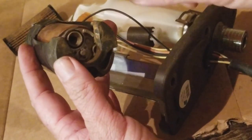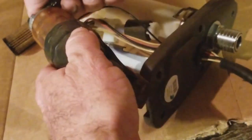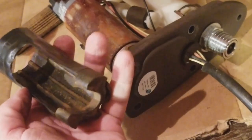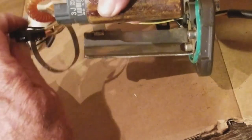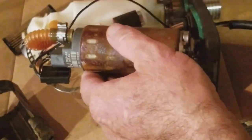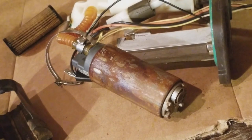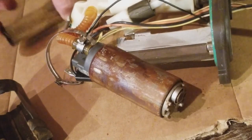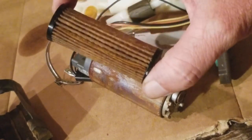You'll see when I go to plug in the new screen for the new pump. All right, so I'm going to recycle this. And then here's my old pump. Unplug here. That comes out. Make sure that's plugged in really good when you go to replace it. And then basically, I'm going to go ahead and undo this hose. I may cut it with a razor blade because I have a new hose to go with it. So let me get this taken care of. And there's our old fuel filter right here. Said and done. So the bike should be running better just with that alone.